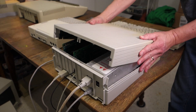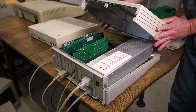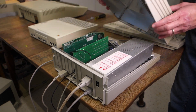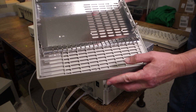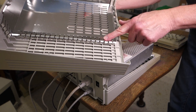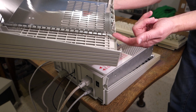Once you've freed the back, you can just swing it straight up and then pull out the front. Don't try to pull it straight up, otherwise you risk popping off some of the tabs at the front of the case. Now looking at the inside, you can see there are all these sharp little metal edges for the metal shielding inside — just be careful that you don't cut yourself on these because they're pretty sharp.